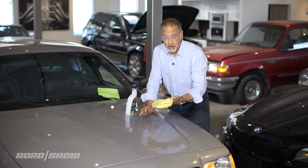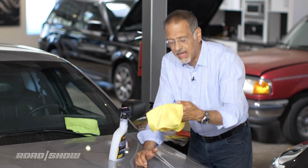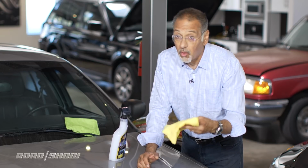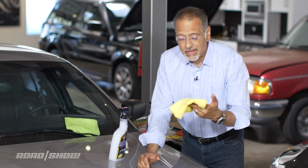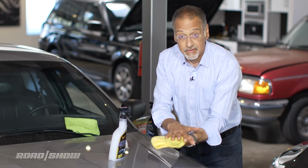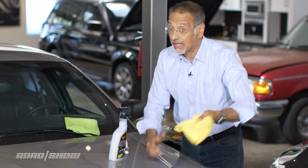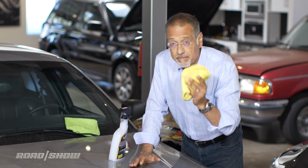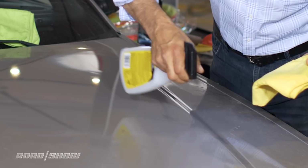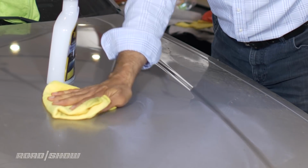Now again, the key here, and I talk about the technique, is to make sure you're not stingy with towels. Too many of us, when we clean windows or do this, we want to use one rag and do the whole car. It doesn't work that way. You're going to throw these in the washer, it's fine, they're not being thrown away. So constantly turn this thing over, every pass, to a clean quarter section, and then toss it in the pile and get another one. You cannot do yourself a bigger favor than to constantly move to clean surfaces of your towel. So now, I'm moving on to quarter number 3 out of my 4-quartered towel.